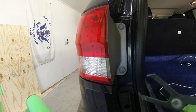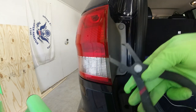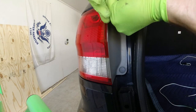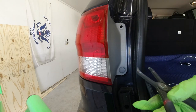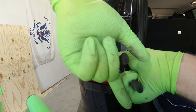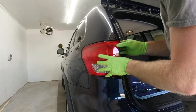To remove the tail lights on this Jeep, you can see there are two plastic push pins that hold them in. I've got these special pliers that are made for push pins — they grab right on the outside of the push pin and make it really easy to pull out. You can also do this with some flathead screwdrivers, but they can definitely be a pain if you don't have the right tool. Just squeeze and pull, and then the light should just pop right out.